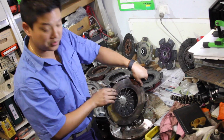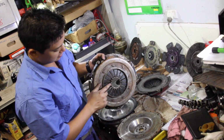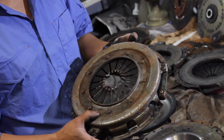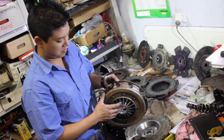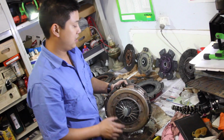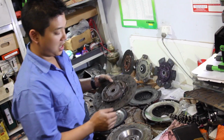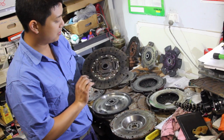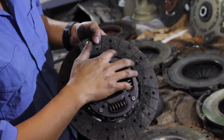And also see, this is the 10.5-inch clutch cover plate or pressure plate. You can also see the difference in diaphragm fingers here. I believe these are either an LS1 or a XR6 turbo pressure plate. Can't quite remember. But yeah, that's a 10.5-inch upgrade. And the first time I got this off, I was running it with a standard organic clutch friction disc, and you can see it's quite torn up from heat damage and slipping through here.